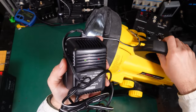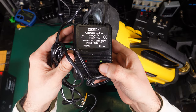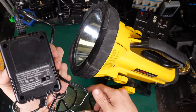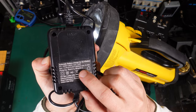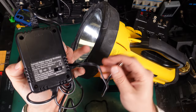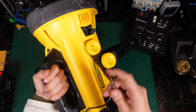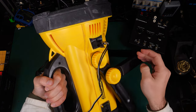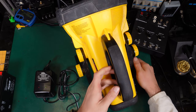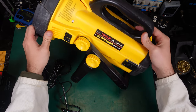This is the battery charger I'm using. It's not a genuine one — it's a generic battery charger. It is absolutely a great charger because it uses a float voltage of 13.8 volts, so you can leave it all the time, keeping the battery fully charged. Using the second port that is directly tied to the battery, you can have it plugged in all the time, always ready for action, without any overcharging problems.